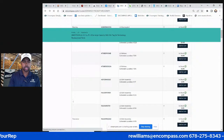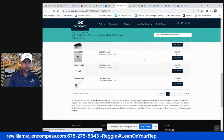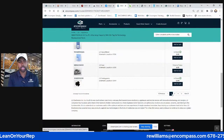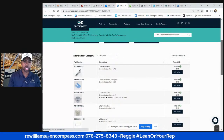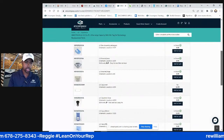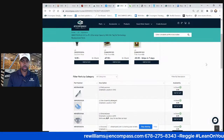So let's get to the main components. One of the main components you'll see an issue with is the shipping bolts. Y'all see my one video I did, one live I did, on shipping bolts. So you get vibrations, heavy vibrations. That is usually caused by shipping bolts still being in the machine.